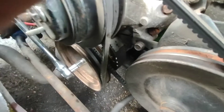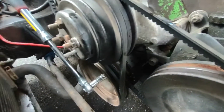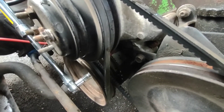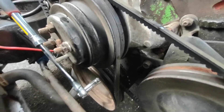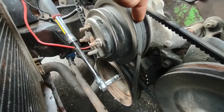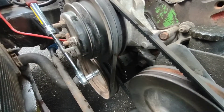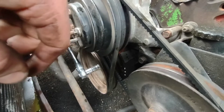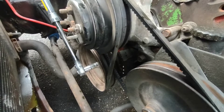And I pretty much came up with this spot right here. I'm going to mark that as zero — I'm going to put like a little star where the zero is. And then what I'm going to do is every 10 degrees that I turn it over, I am going to mark it. And then from there I will be able to get it right in time where it needs to be.